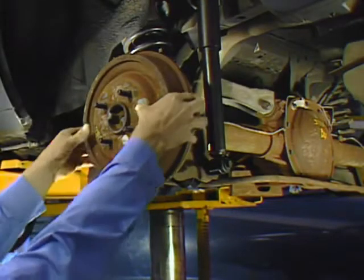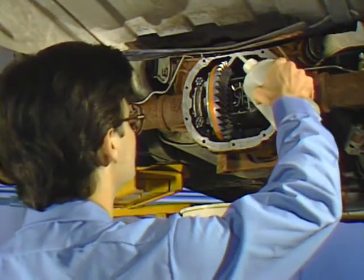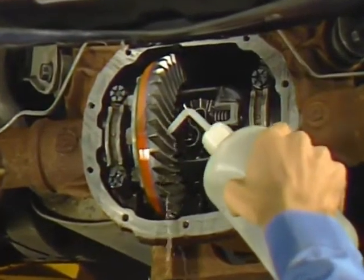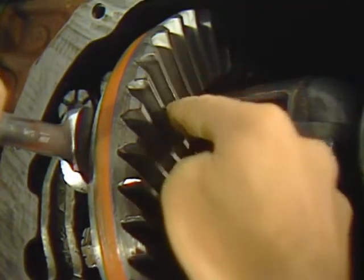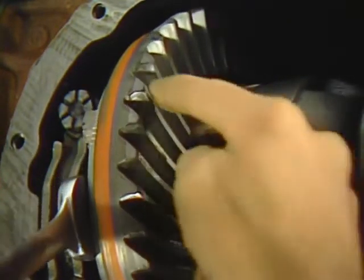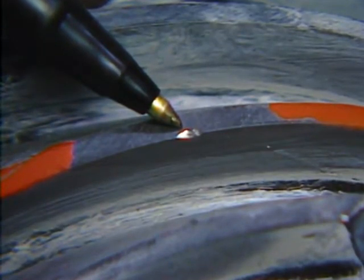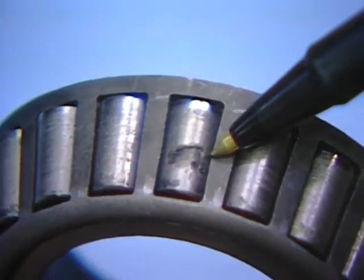When you have determined that the problem is in the gear and pinion set, put the vehicle up on a hoist and remove the rear wheels and brake drums. This is necessary to remove the axle shafts. After draining the lubricant, wash out the interior of the carrier and the gears thoroughly before inspection. This is very important because any residual oil left on the gears can add as much as three to five thousandths to the backlash readings, giving an incorrect measurement. After all parts are thoroughly clean, inspect for any nicks, scores, spalling, or uneven and excessive wear. Any nicks or chips on the pinion gear or ring gear teeth can cause a clicking or ticking noise. Even small nicks can cause problems, so the gears should be examined in a good light. Brinelling in the differential case bearing cup caused by over-torquing the bearing cap can cause a roaring noise, as will spalled or galled bearings.